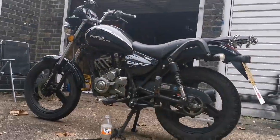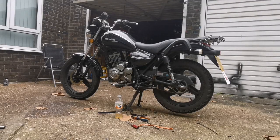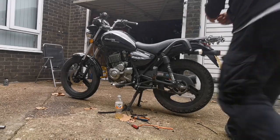So my next thoughts are that I can't get the system to flow enough because it's too tight and there's wiring there. I'm going to whack the seat off, whack the side panels off, see if I can loosen that wiring enough to move it slightly out of the way to get better flow with this fuel filter in place.